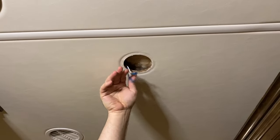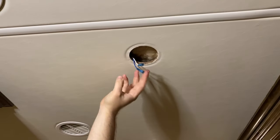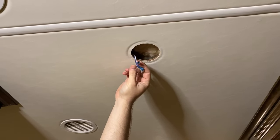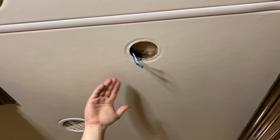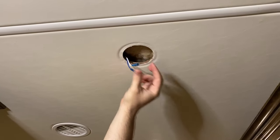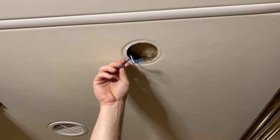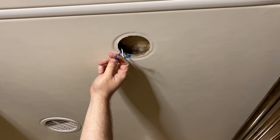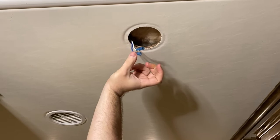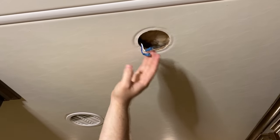Normally these lights have butt connectors that are soldered together. I like to cut those off and replace them with the quick disconnect, so that way if in the future I have to replace these lights, it's easier and I don't keep cutting wires — I can just pull them out and put on the new light. I've already replaced this light once before, so I already have the quick connects on here. All we have to do is put the male ends of the quick connect on the new light, and we can install our light.